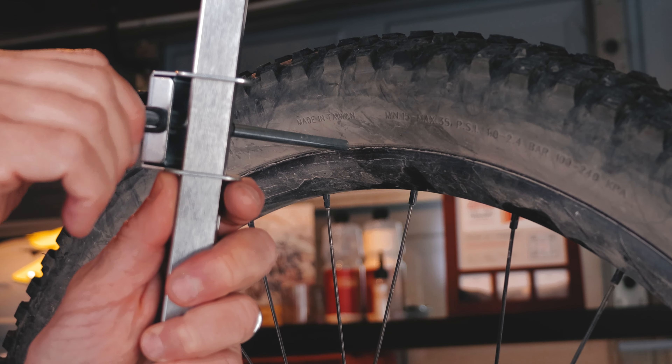Remove the tool from the hanger and reattach the rear derailleur. And just like that you've got crisp shifting and a properly aligned rear derailleur. Having a spare hanger on hand is always a good idea, especially if you ride in more demanding terrain. It'll ensure you're prepared for any crashes and can get back on your bike as soon as possible without having to wait for a replacement part.